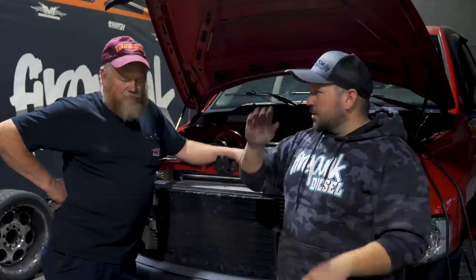We also installed our staging limiter. Yep. So he's got a button now on his brake pedal that anytime that button is pushed, he can go flat to the floor and get to 24, 25 pounds of boost for a staging limiter. I'm going to put this thing on a set of radials. He should be ready for racing. Yep. 345s are ready for it, and we'll try it in 2 weeks, and I'll let you know how it does. Well, good luck to you.